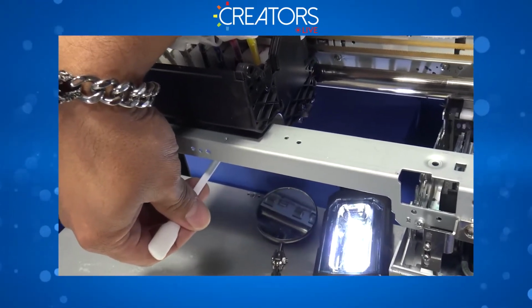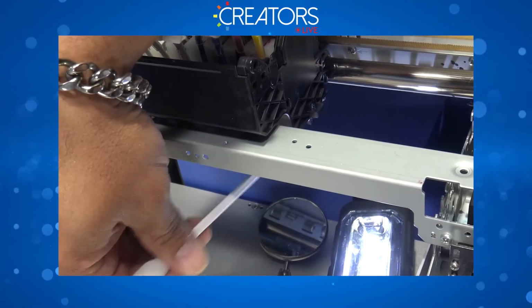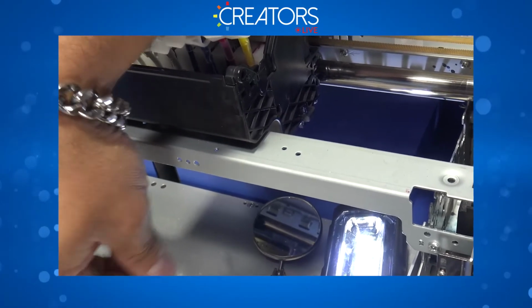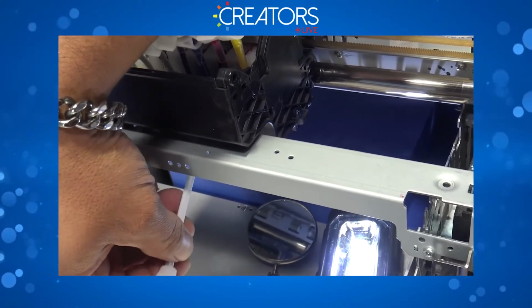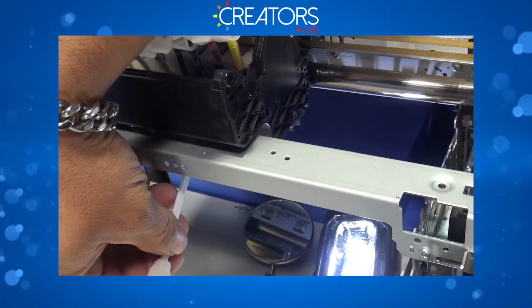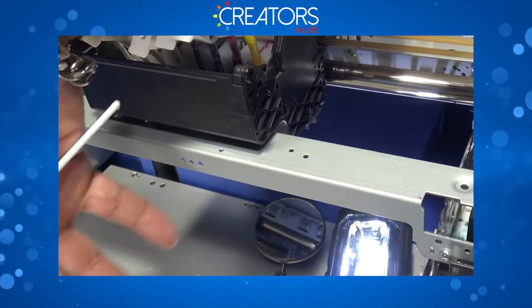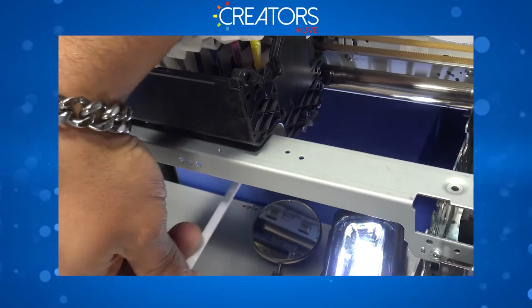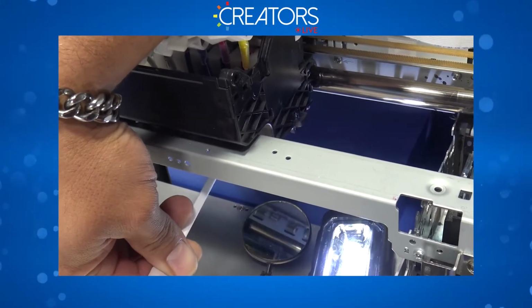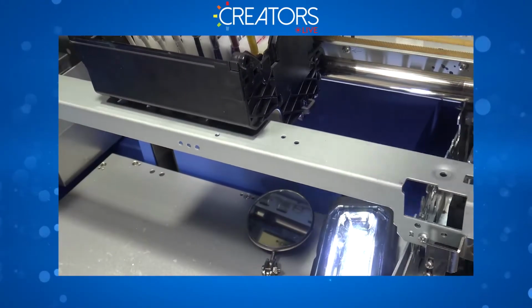Always avoid at all costs touching the mirror plate. We do not want to touch this mirror plate with anything, not even with the sponge, not even with the microfiber cloth, okay? So always stay away from this mirror plate. This is where your nozzles are. You cannot see them here, but in case you happen to have an old print head, you can put it against the light and you're going to be able to see 8 lines. Those lines are the holes, the nozzles where the ink gets sprayed off. So again, never touch this mirror plate.